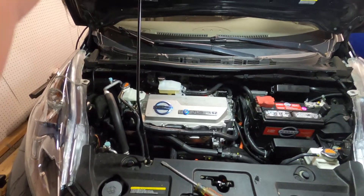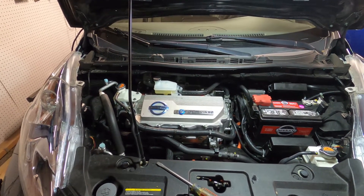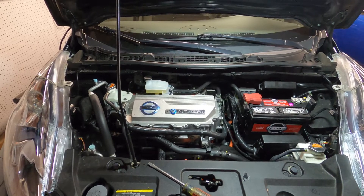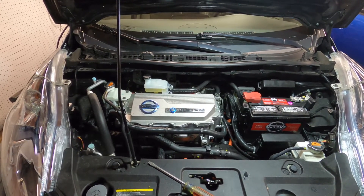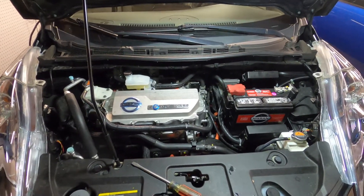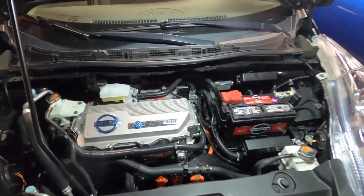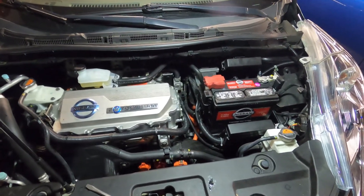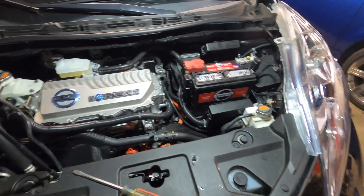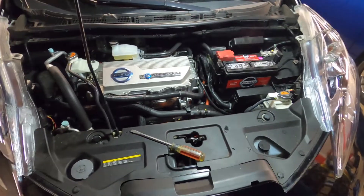Also, before I forget: when we were taking the PTC heater out the first time, we took it out without the bracket. We found out that it will slide out easily with the bracket — so leave the bracket on when you're pulling that out. And there are four bolts up top below the battery that you're actually supposed to loosen; you don't undo it from the bottom. It's four bolts you have to push the ratchet and socket through coolant hoses to get to on the left side — they're open on the right. Take those off and then it slides right out.